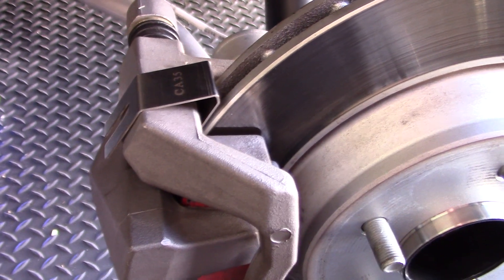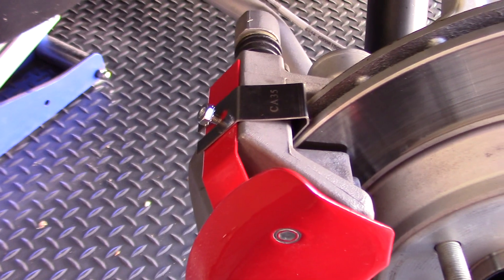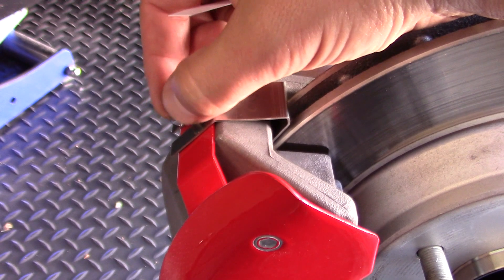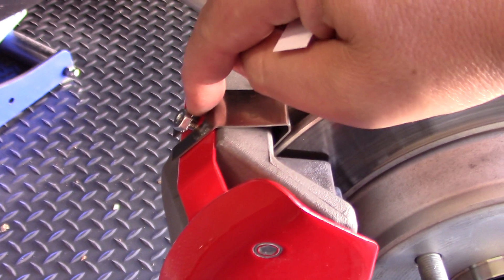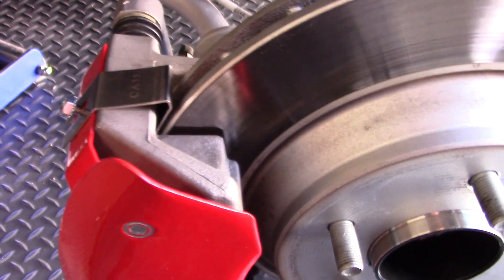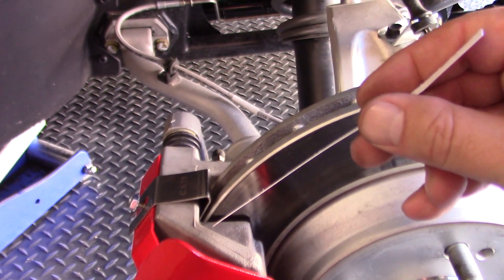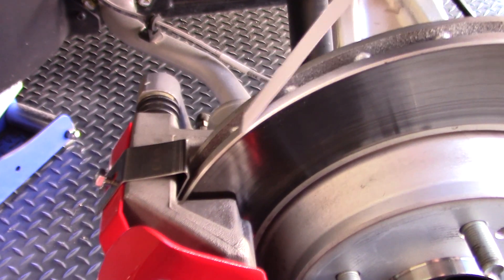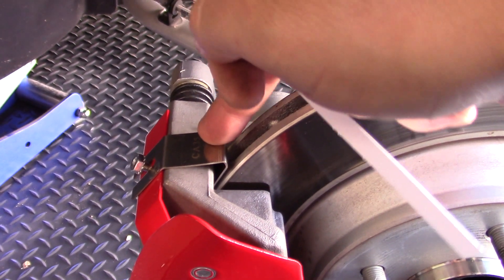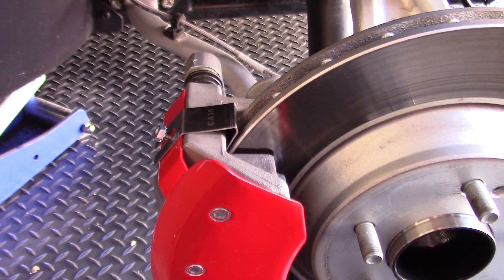I have both the upper and lower stainless steel mounting clips holding my caliper cover in place. I'm going to tighten down the lock nuts with the star washers that come with the kit. Once those are snug, the final step on both upper and lower clips is to grab the gap checker — which is about the width of a business card — and make sure you have clearance between your rotor and your mounting clip. I'm going to go ahead and tighten these down and show you what the finished product looks like.